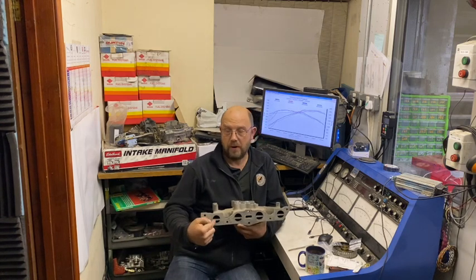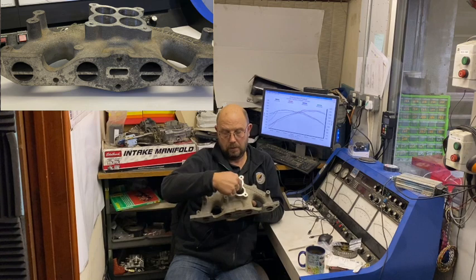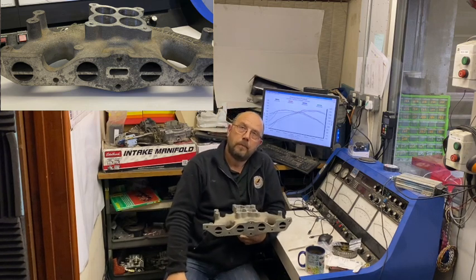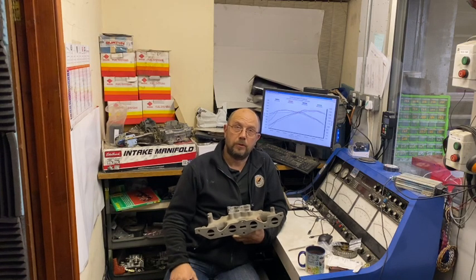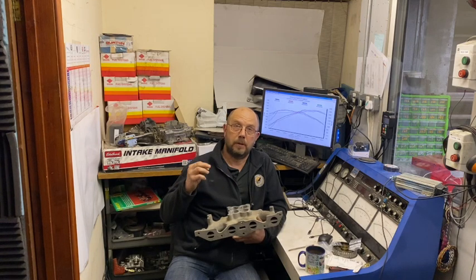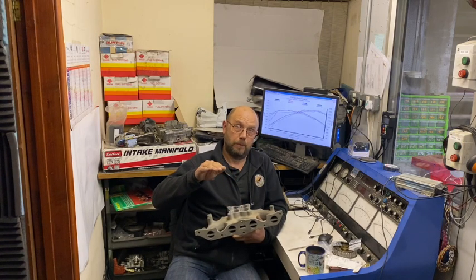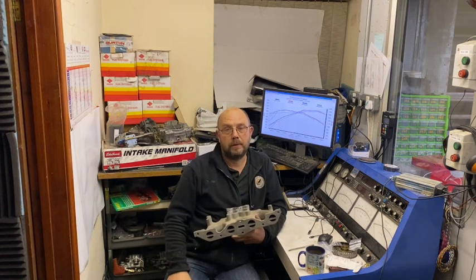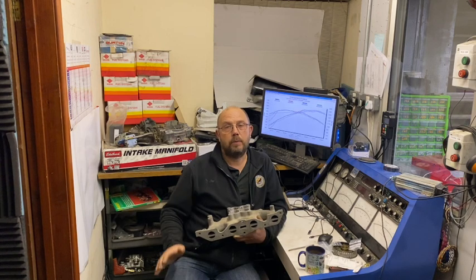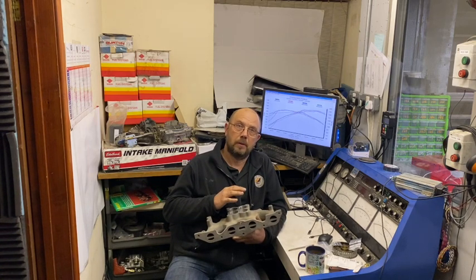But this Offenhauser manifold is neither dual plane nor single plane — it's dual port. That means they put a divider up the middle of the manifold and each half is fed by all the carburetor barrels. I think in this case it's just such a convoluted, awkward shape that the manifold will not flow sufficient air for the engine to make use of the big carburetor. And if you look at the graph in green from the Holley, it appears the Holley actually gives much better low-down power below where we tested. So I think had we been able to get hold of a Weiand dual plane manifold, the Holley would have outperformed the twin choke Webers.